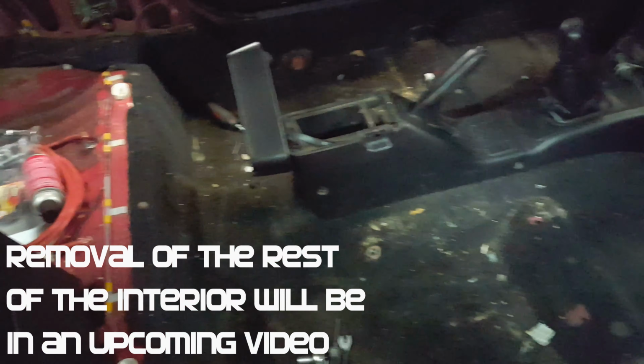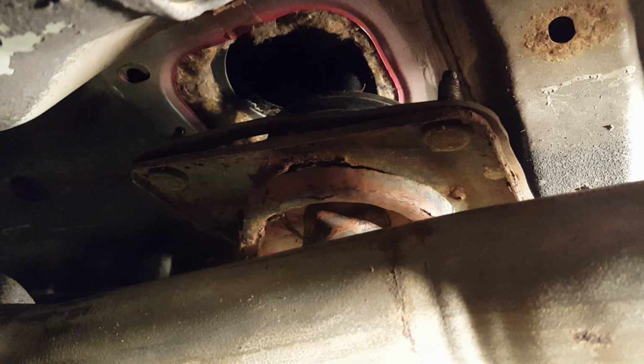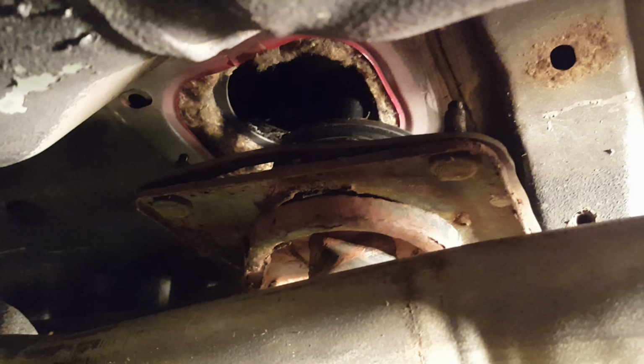Hiding in the back. Now to get the console out, there are four screws. One Phillips head there, Phillips head there, same thing on the opposite side. I'll take those out next. So at some point I'm going to figure out how to get this out. But for now, the screw that I need to access is right underneath there. And I lift this plastic up, or this rubber pad. And there it is. Now I got the two on the other side off. And so I'll get that one off, and then there's another one up forward. And then the shifter should drop out, and I should be able to reattach the other end. So there's the shifter, dropped away from the body.